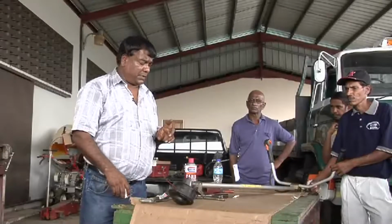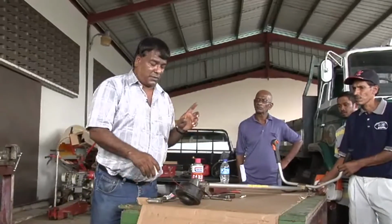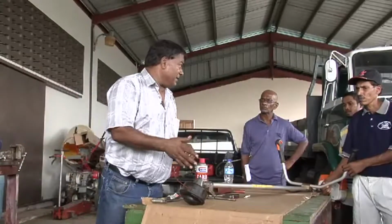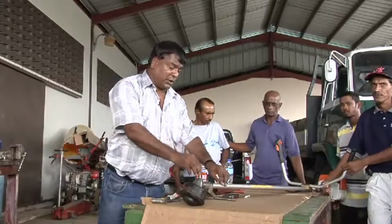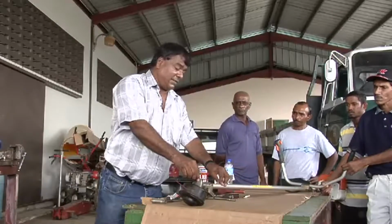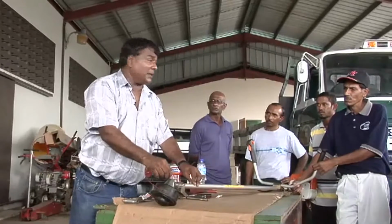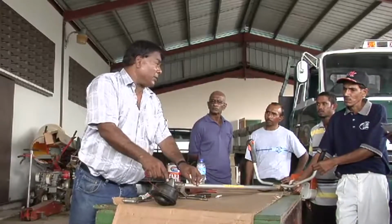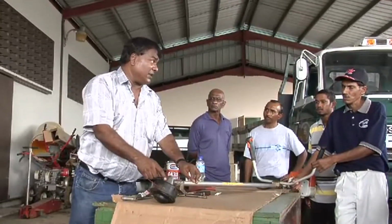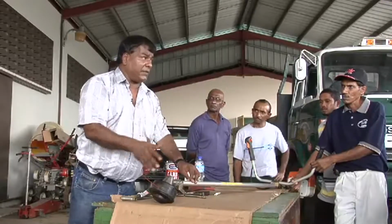The next step is servicing the gear head on your brush cutter. On your other small engines, like a lawnmower, you wouldn't have this. This brush cutter has gears in this housing. If you do not service this, it will cost you quite a bit of money, because this might cost about $1,500 to $1,700. And if you service this routinely, this should last the life of the machine.